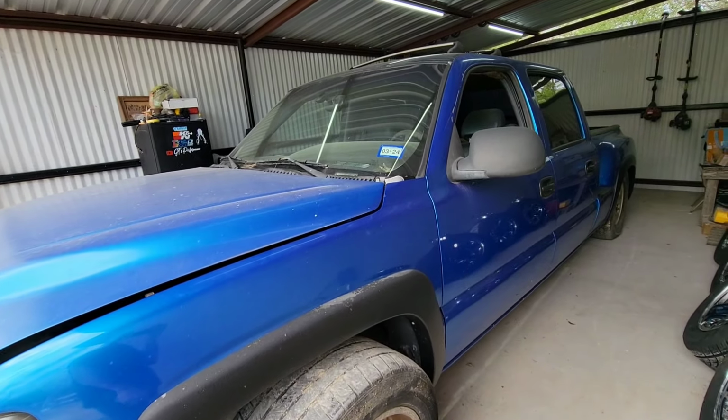And aside from that, right here I have 3 leaf springs plus the support. When I was doing the notch, I actually took off one of the leaf springs because I thought it was an add-a-leaf that I had installed when I had the truck lifted. But it turns out it's just lower, way lower from the back. And installing these new tires, it's going to go a little bit lower since they're shorter than the ones over there. So I'm just going to install the leaf and then install the shock, and then we'll install the tire. Okay, so this is a 4-inch clamp.